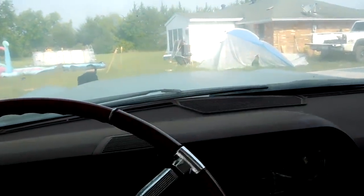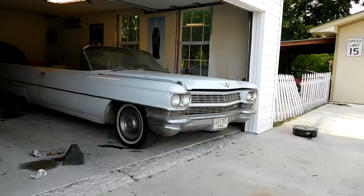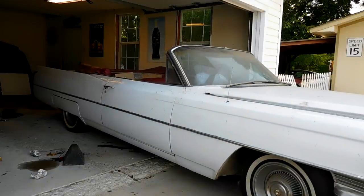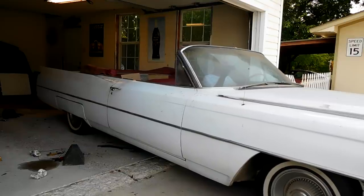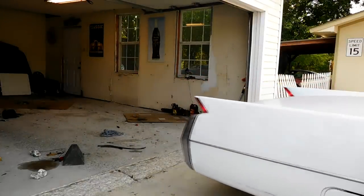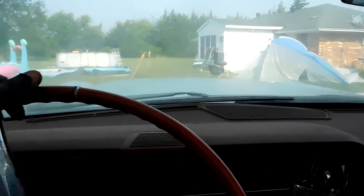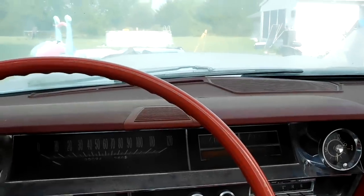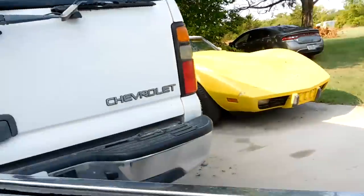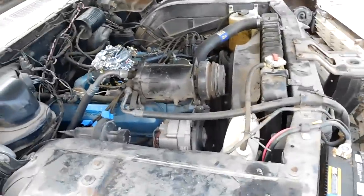She's moving! The brakes sort of stop it. I have a high tire on the car. Power steering feels like it works — maybe not. We need to get this thing warmer so that we can see if the transmission needs fluid. All we can do is wait for it to warm up and then check the transmission fluid — I bet it needs some for sure.